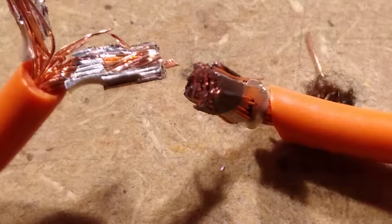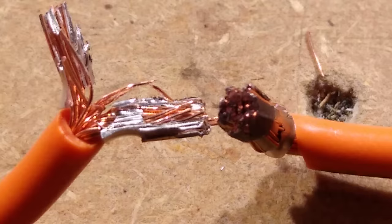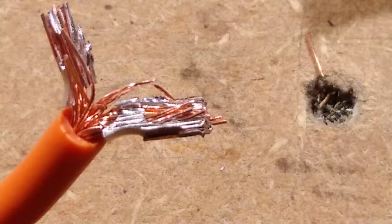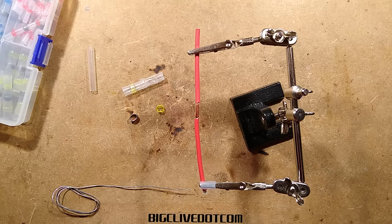It's hard to say how good that is. I don't have as much confidence as I would have if I'd actually used solder and flux directly and then put a hot melt heat shrink over it. But having said that, this is definitely a lot easier and it's a very good quick fix. It just doesn't seem to have quite the penetration of a proper solder joint, but it's still probably better than a mechanical crimped connection.